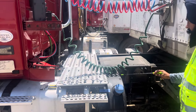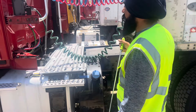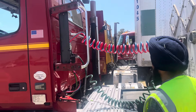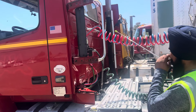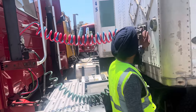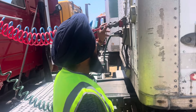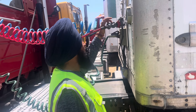Tractor frame: no illegal holes, no illegal welding. Next is coupling from tractor to trailer. Air lines securely hanging, not touching the catwalk or frame, securely mounted, not cracked, no leakage, not bulging. Glad hands: the tractor side glad hand and the service pod — which is the trailer part — securely mounted both sides, not cracked, no leakage, good seal, not leaking. Red for emergency, blue for service.